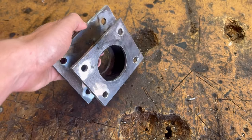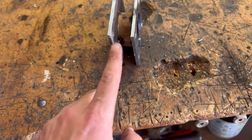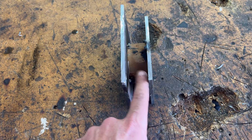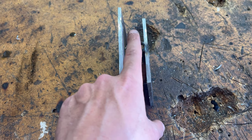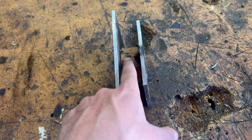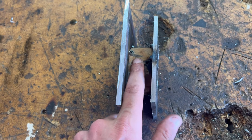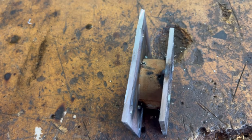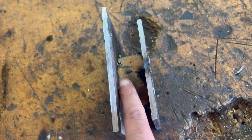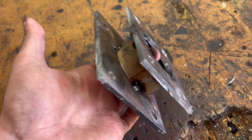This is what it looks like — it's not too pretty at the moment. Once I cut the ends of those studs off it did allow me a bit more clearance through here. This is 2mm wall, 2.5-inch exhaust pipe. Anything smaller will foul on the boot on the brake booster, so 2.5 inch is where it's at. It's 30mm from end to end.